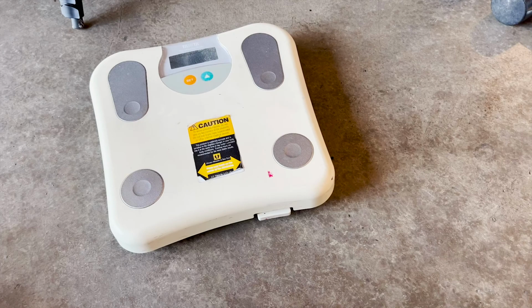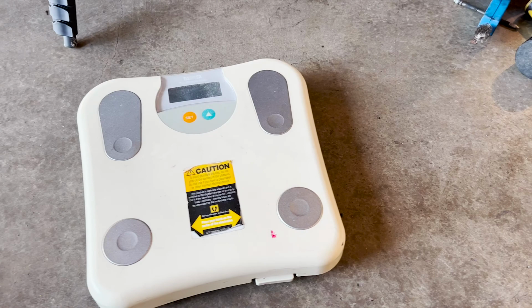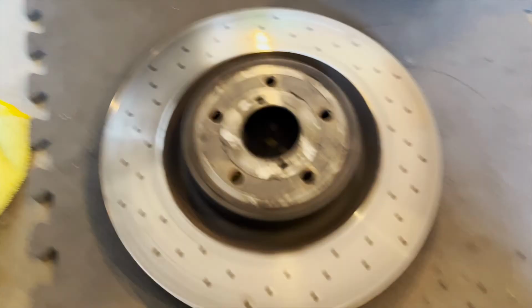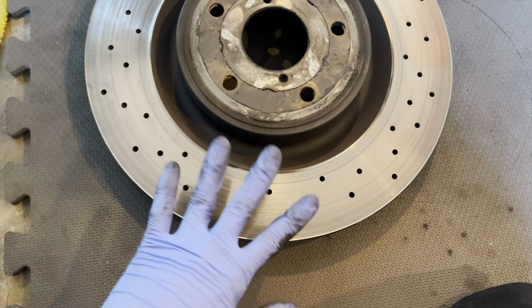But again, when you drive it, you probably won't feel it, but you'll feel the cooling effects. And when you go on track and lighter wheels, everything, it will be much better with the less unsprung mass. So yeah, pretty substantial, 4.5 pounds. A lot has to do with the two-piece rotor, the aluminum 6061 hat right here, compared to this one piece right here. And this does feel heavier. Both of them are heavy. Brake discs are generally heavy unless you have carbon ceramics, but I'm pretty weak, so disregard that. But yeah, overall, I'm really happy with the weight.